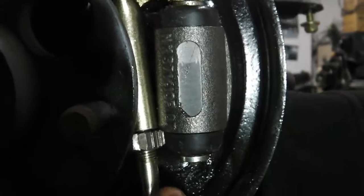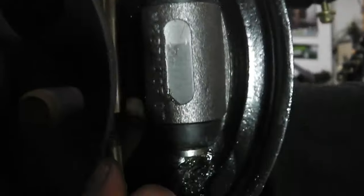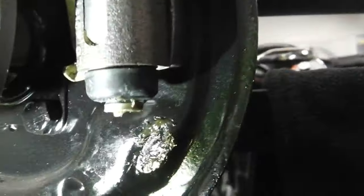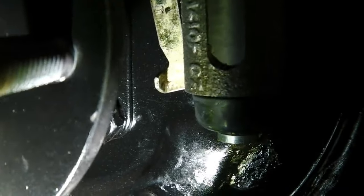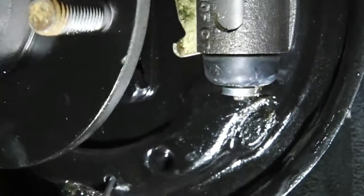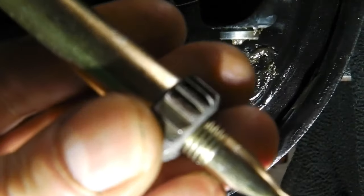What happens with this adjuster is, it's gone up now, when I pull on the handbrake, let's take it out so you can see what I mean, and we'll bring the light in now. We'll have a detailed look. You can just see, middle of your screen now, there is attached to the pivoting point of the handbrake lever a little arm, and on the end of the arm it's got a pin. It pushes on the ratchet of this wheel. Here's the wheel, and this pin touching it now turns this ratchet adjuster, which operates the threaded fork and makes this go longer.